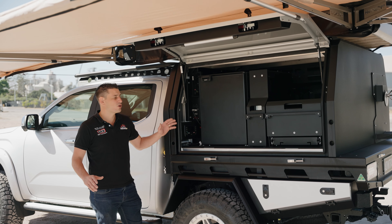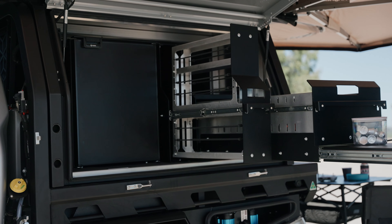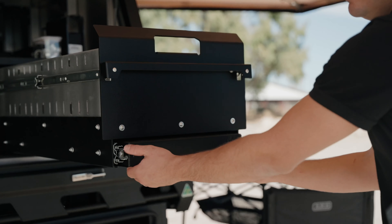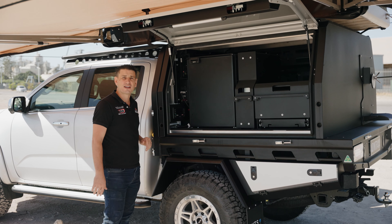In the canopy itself, we've gone for a 1500mm canopy. The reason we've gone for this size instead of a full-length or one-metre canopy is because we want to put spares on the back. We don't want too much weight past the rear axle, so stopping your canopy 200mm short is a really good way of putting the spares on the back without compromising the quality of the ride.